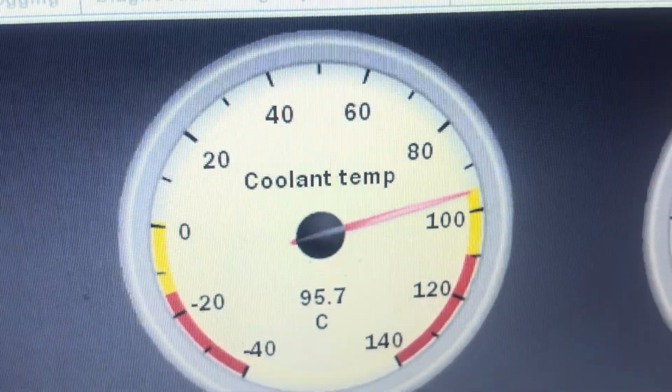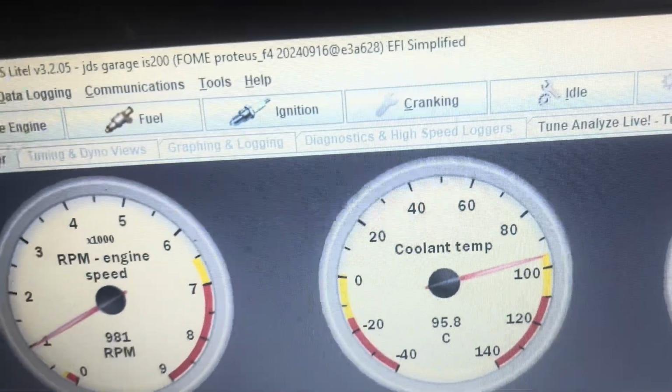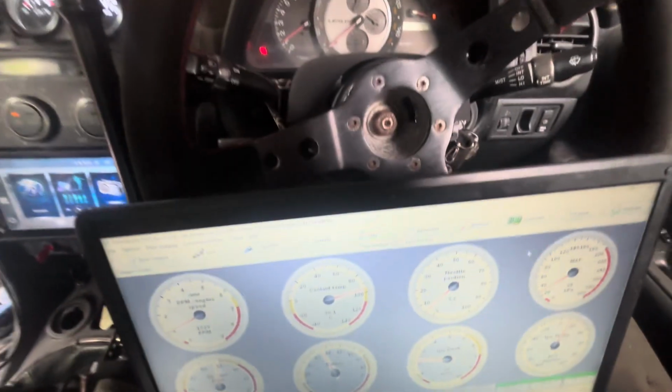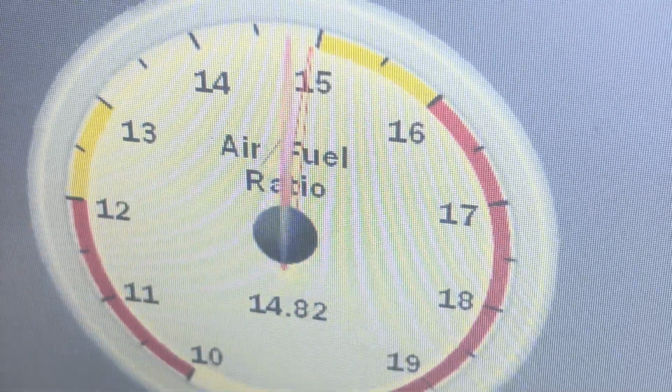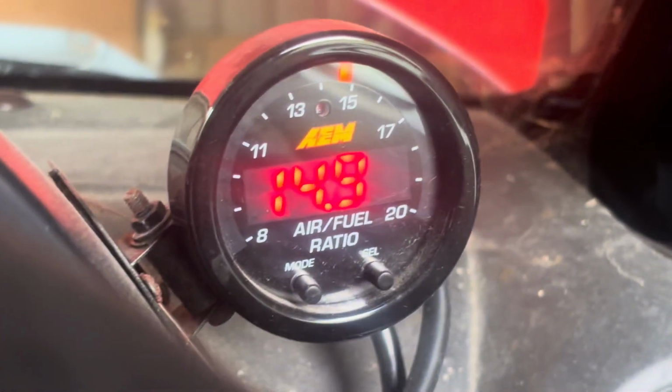What temperature is on the ECU? So yeah, the car is warm. Right now I have the fan set up with the switch. I think I'm going to put the fans on the ECU so the ECU controls the fans. So yeah, now the car is idling at 14.7. Yes, I have two AFR sensors in my car at the moment.